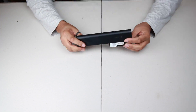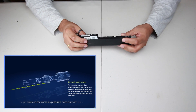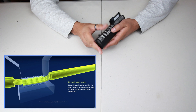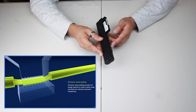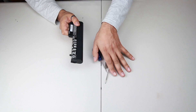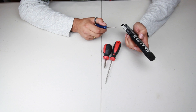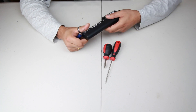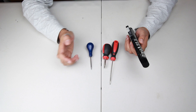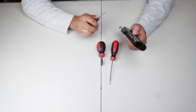So you've got yourself a battery pack. Most of them — probably all of them — are going to be sonically welded. This is the process of putting two pieces of plastic together and vibrating them to the point where the mating surfaces create friction and the plastic melts together, fusing both cases. There will be a split line and you should be able to work that apart. You would need something to poke through the shell — typically you would enter from the power supply socket. If using a screwdriver with a small flat head or even a spike, you've got to be very careful about short circuiting.